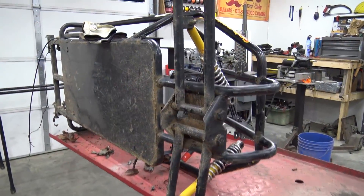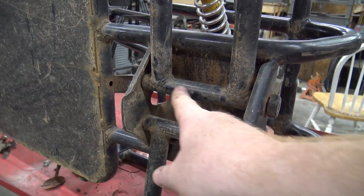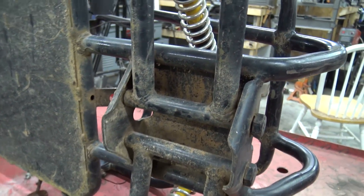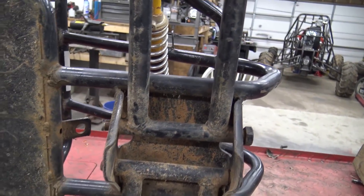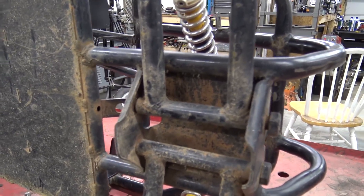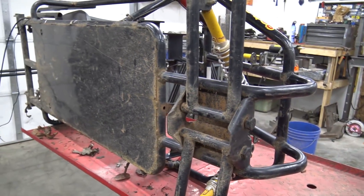We got everything like the steering shaft and tie rods pulled off. These bolts are bad about rusting themselves to the a-arms - they don't put any grease fittings on anything. As you can see, it does not move, it's just moving the a-arm side to side. Daniel's going to take a saw and cut both of them right there to get these a-arms off, and we'll start mocking up our new front end.